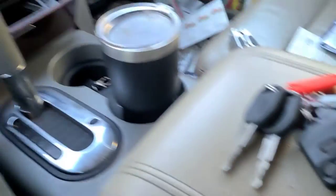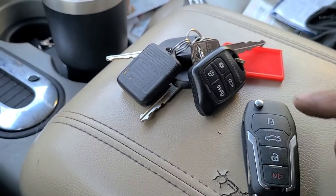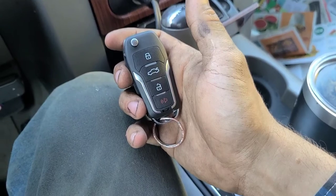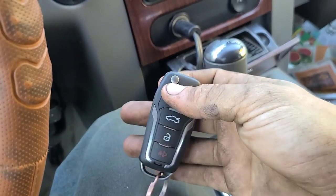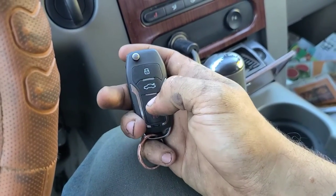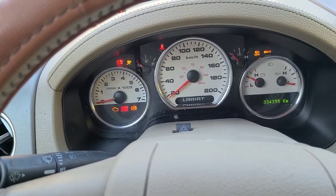This eliminates all of that because my command start allows me to use my fob to start the truck. All I gotta do is hit the lock button three times. The way mine works is I have a CompuStar remote start and it has a security immobilizer — when the command start is activated it sends the same signal as the master key. There's a clone of the master key and it sends that signal through an immobilizer. So doors are unlocked right now — lock, lock — and that'll work.